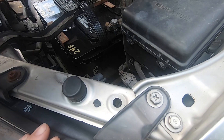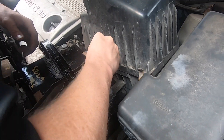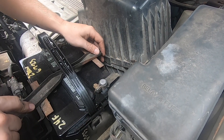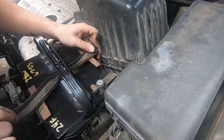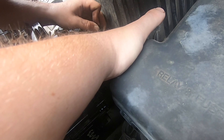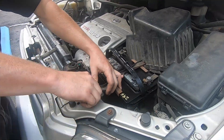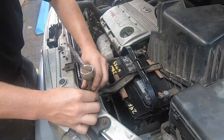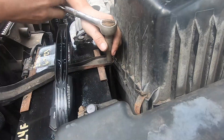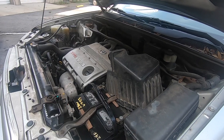These types of brackets can be tricky — it seems like a lot of Toyotas and Nissans make brackets with hooks that have to hook underneath the battery box itself. Take your time and make sure you know what you're doing. Once you get that done, install those bolts back in and that will tighten up the hook. This is how you install a battery in a 2006 Toyota Highlander. Start your engine!